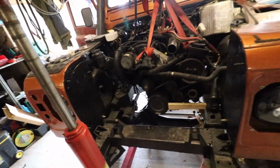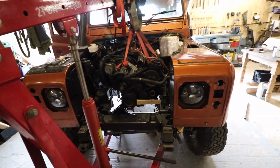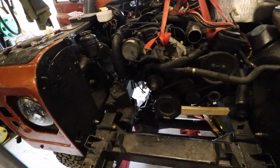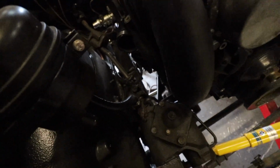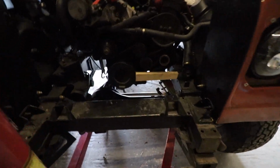We've just used a bit of wire to mock up the mount on this side, and Duncan, a friend of mine who does a lot of metal welding and fabricating, has just gone back to the shop where he's going to fab up that engine mount for that side. While he's doing that, I'm going to clear a bit of space over here so that we can get in there and just mock it up a bit nicer. And then what we're going to do is just tack weld that engine mount on that side in place, so down here,